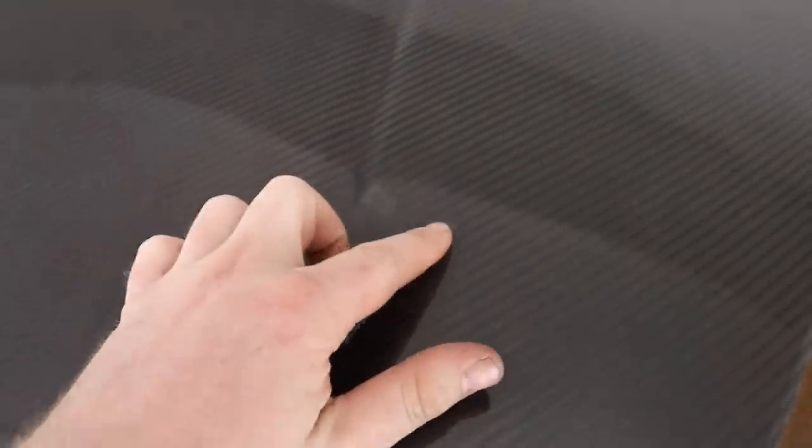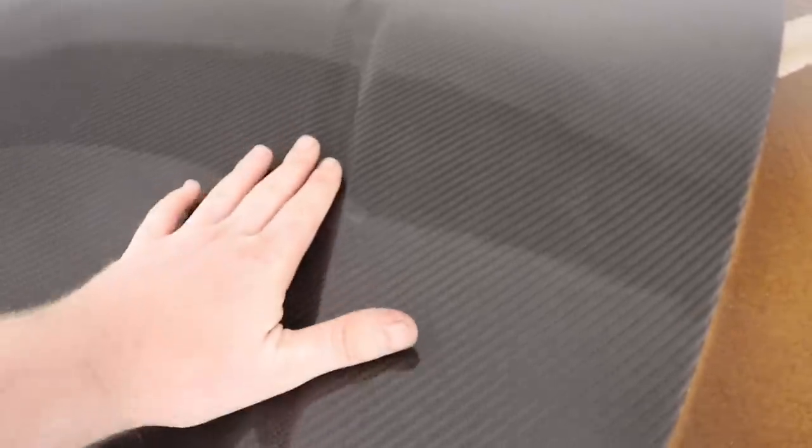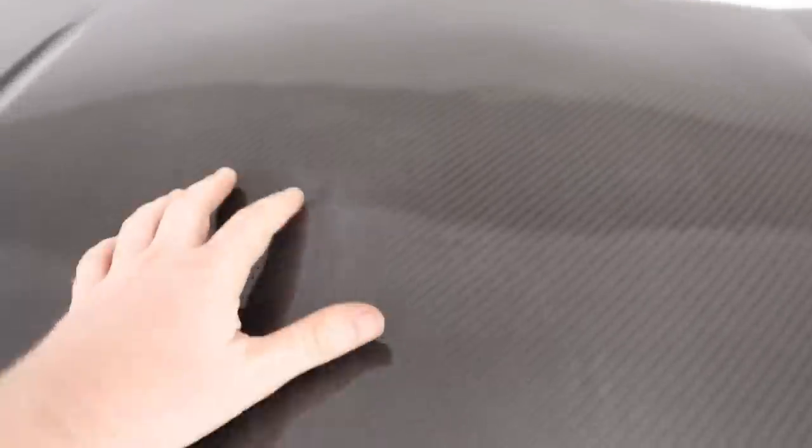We had some fogging right here where this fogged up and got a little bit of weird whiteness to it. That happened at the first layer of resin. We threw the roller over a little bit of resin way too late in the game, and it made that. And I think we had some of that happen over here too.